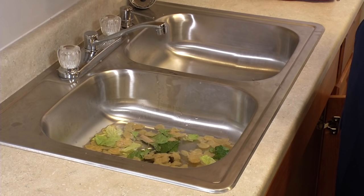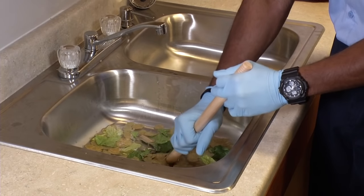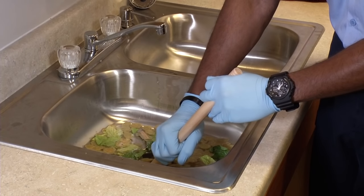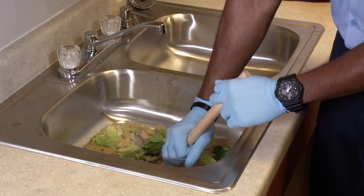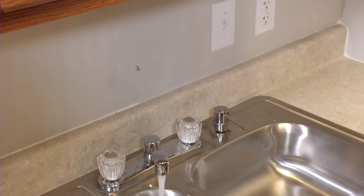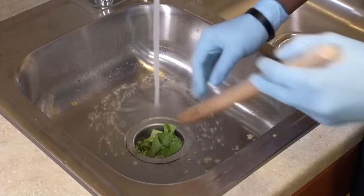Some disposals don't have the hole in the bottom, but you can still clear the jam by using a dowel rod or the end of a wooden kitchen spoon. After making sure the disposal's power switch is off, push the dowel into the drain hole and hold it firmly against one of the impeller arms, then push it in the counter-clockwise direction. This accomplishes the same thing from the top of the disposal as the jam key does from the bottom. Once the jam is cleared, be sure to let the water run long enough to wash the obstruction down the drain. Avoid putting your hand inside the disposal — if you need to extract something, try using a pair of pliers instead.